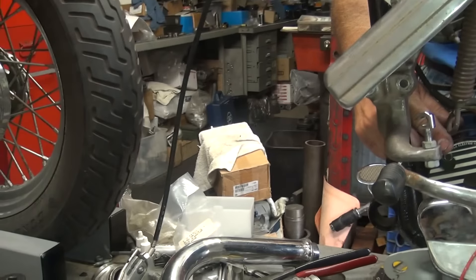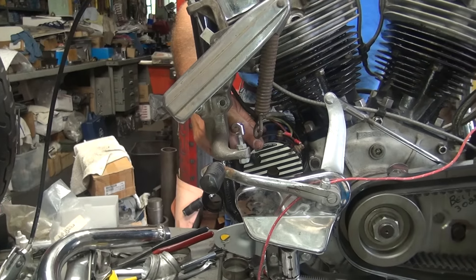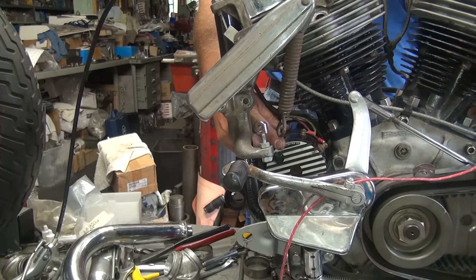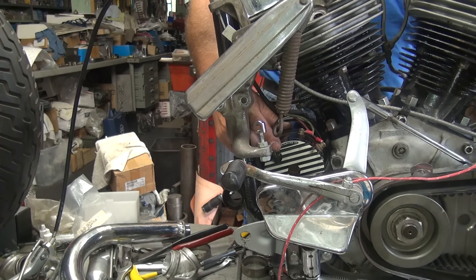See the generator right here? We've got one red and one green. Red's going back to the hot side of the switch — which is a black wire, not a red wire, which is normally right. The red is coming up to the switch, battery side. And the green wire is going to the light — whenever you get the dash, it's a three-dash thing, it'll go to the light that says generator. So that's done.